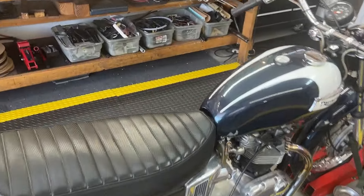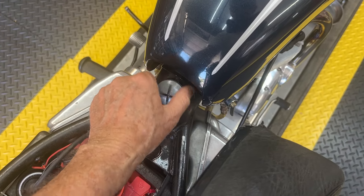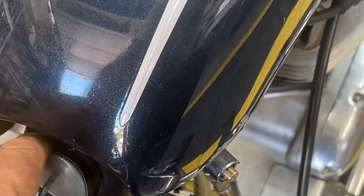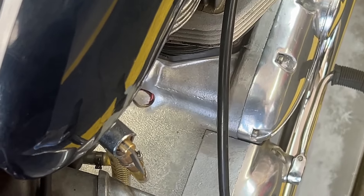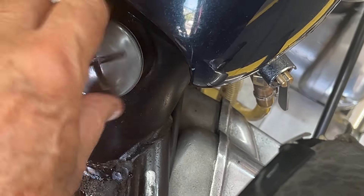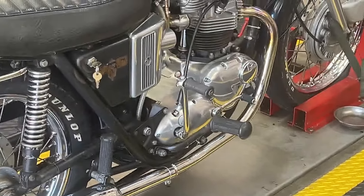I've got good oil flow. That's brand new, pristine oil — it's made for wet clutches specifically. 20W-50 weight. I'm going to let it sit here and idle for a while, just let it warm up for a few minutes.